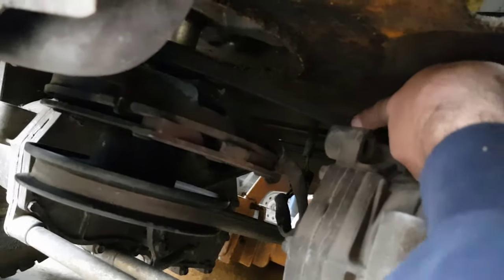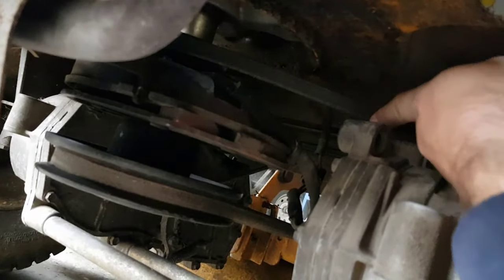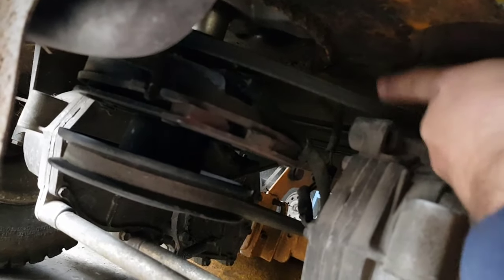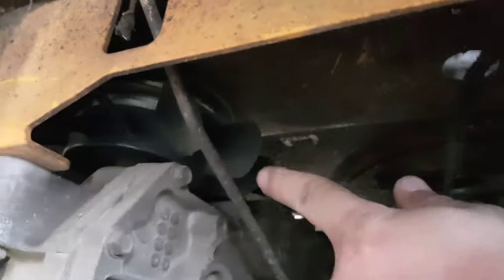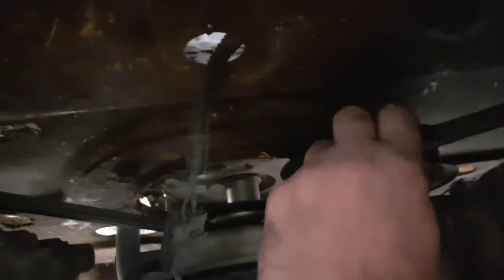Also, when I was using it a few days ago I was going up a little hill that it wouldn't go up at all, and I could smell the belt actually burning. You can see the belt is right here — it goes to that hydrostat and then it also goes to this hydrostat, goes up all the way to this pulley, and then this is the tensioner belt right here. As you can see mine's pretty loose.